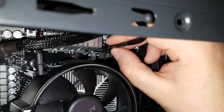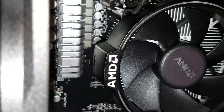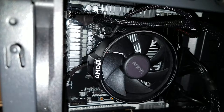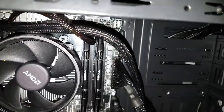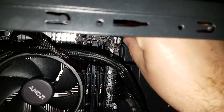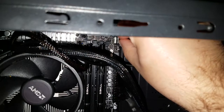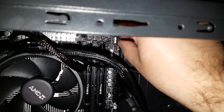Next, you'll want to connect the fan to the motherboard CPU header, and then connect the RGB cable to the Wraith Spire cooler. You'll want the raised clips facing you, as it can only go in one way. You'll then want to connect the RGB cable to an RGB header on the motherboard. Unfortunately, with what we have here, either the RGB cable is bad, or the motherboard RGB headers are bad. I haven't been able to ascertain which yet. I'm hoping it's just the cable.